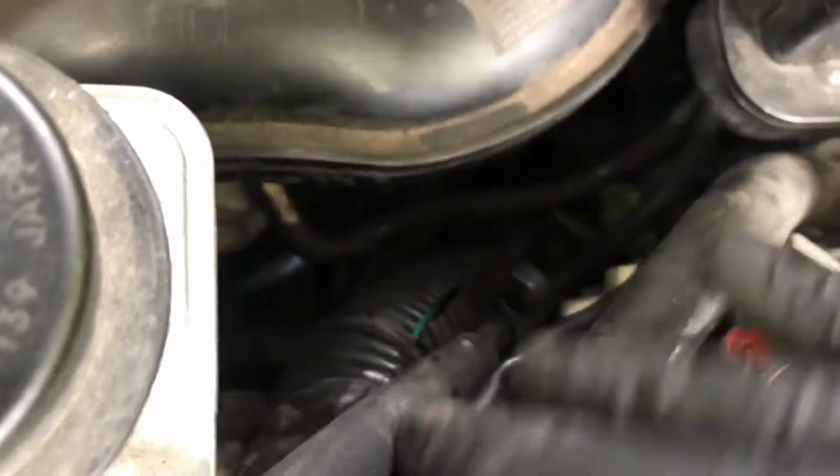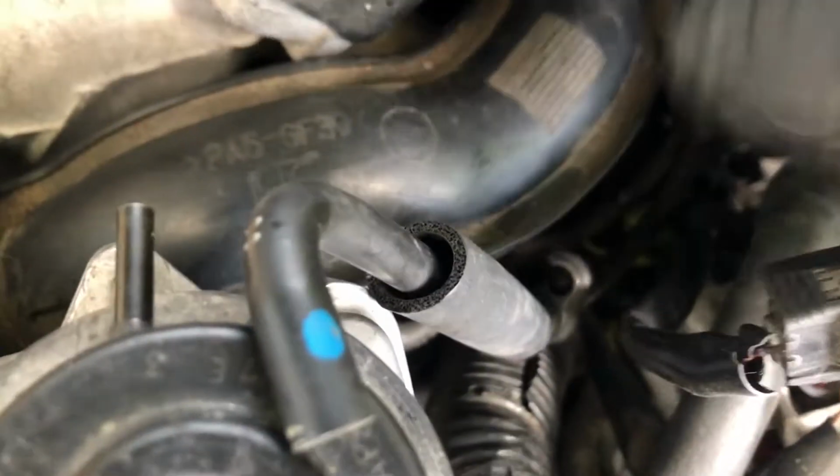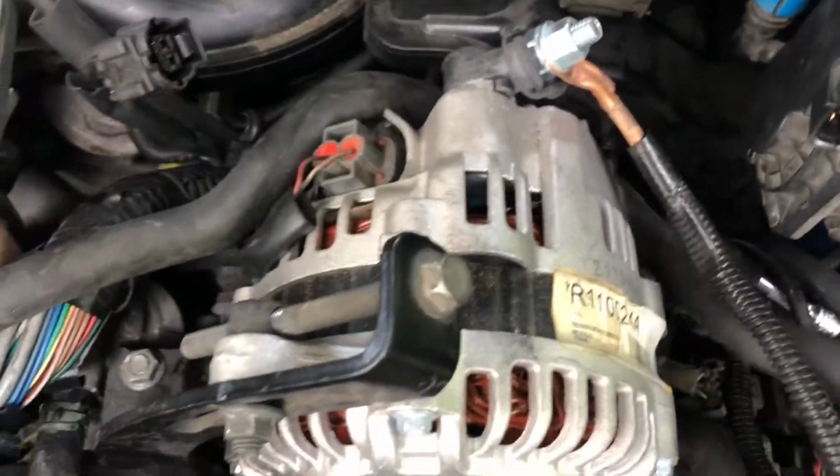One thing I will say right here, it's kind of hard to get to that one vacuum line on that regulator. So ensure you pop those vacuum lines, those 2 down here first, before bolting it down here, or you won't be able to get to it. So I went ahead and plugged those 2 down below first, then I went ahead and mounted the top side. So I'm gonna go ahead and finish up installing all the vacuum lines and electrical connectors.